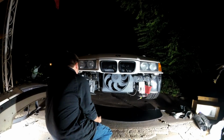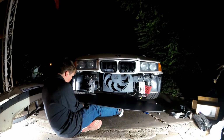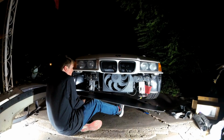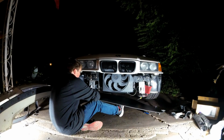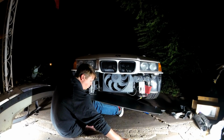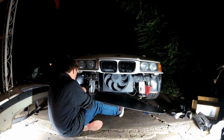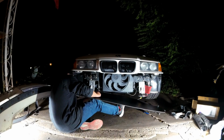And I'm going to start up at the front. I'm just going to support it underneath with my foot, put the bolt up, and I'm going to slide that first bolt up and in, slide a lock washer on that, and get a bolt down. I'm going to do the same for one of the back ones as well, so that we're fully supported right now temporarily on this side, front and rear, so that we can jump over it and put another one on the other side.